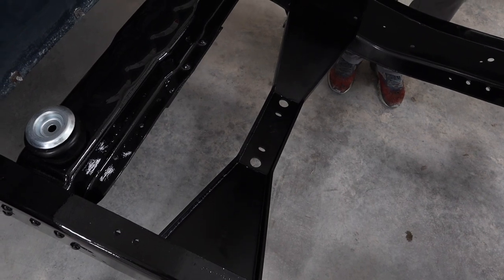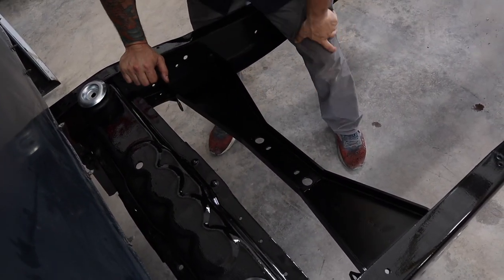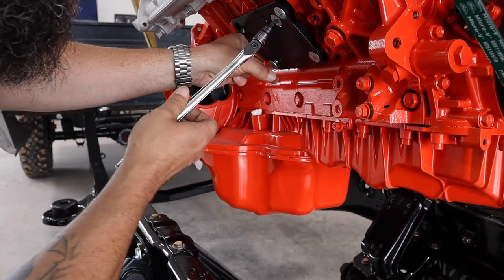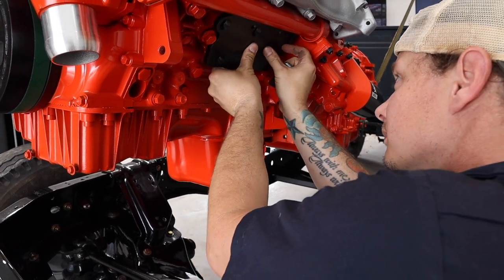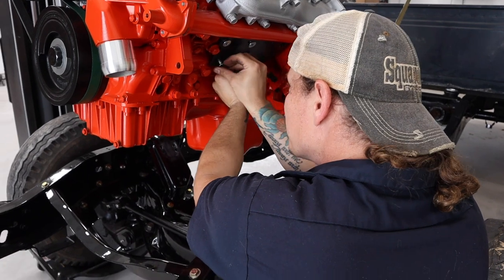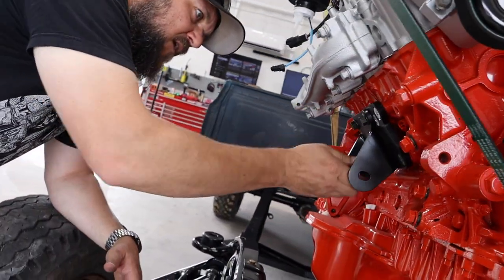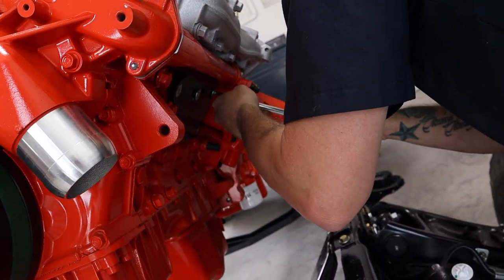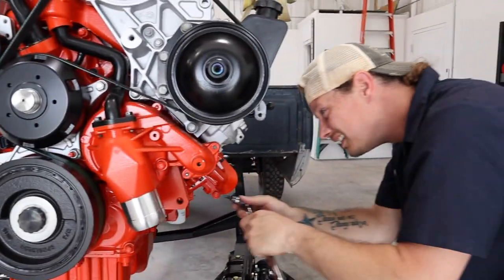It's going to be a little bit of a fight to get this down. You're supposed to use a port-a-power and spread the frame rails out a little bit to get this in, but I don't have a port-a-power, so we're figuring out a different way — we're making it work. I need to take some install shots to send over to Robert. These should be the same torque spec as your 15s back there — 38 pounds. We forgot to put the frame-side mounts on, so now we get to do that with an engine hovering above us. Danger — I like danger.